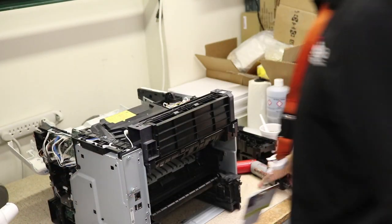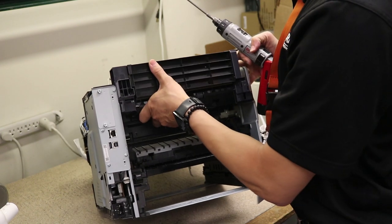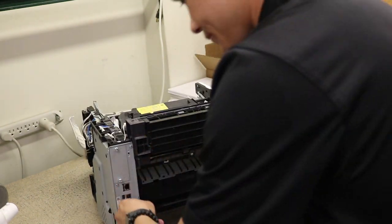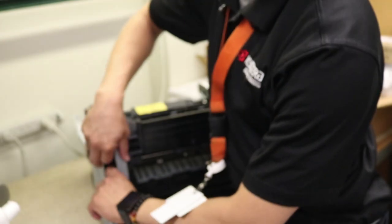And now, we're going to remove the board, like the NIC card. Right here, all this. Bring it off. Just take every screw off of here. Okay, all the screws are off. Now you can slide this right out from the back. Board's out. Put that somewhere.